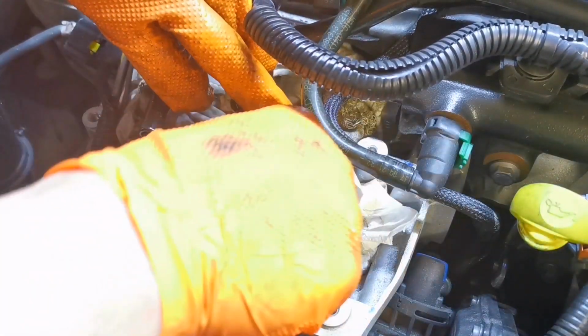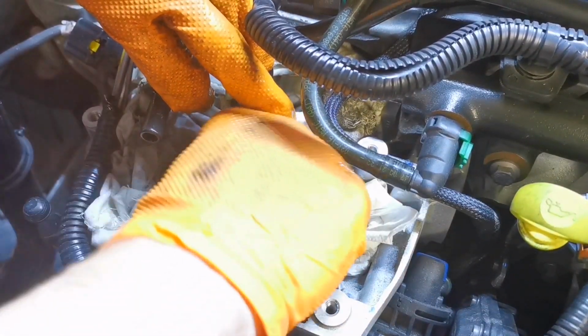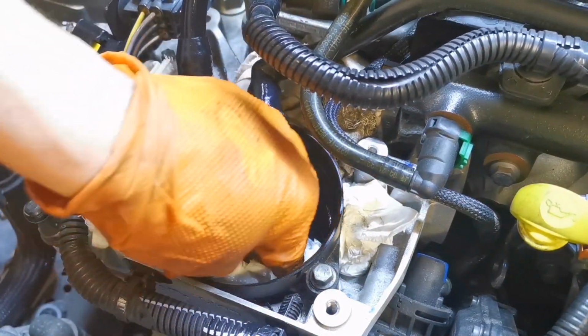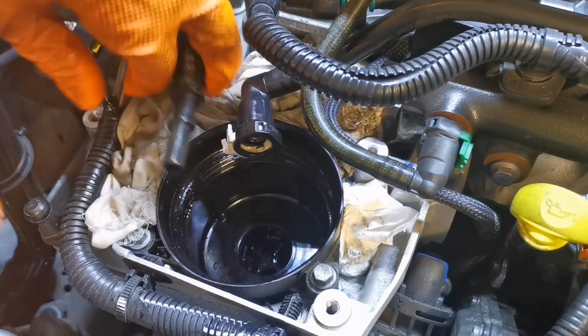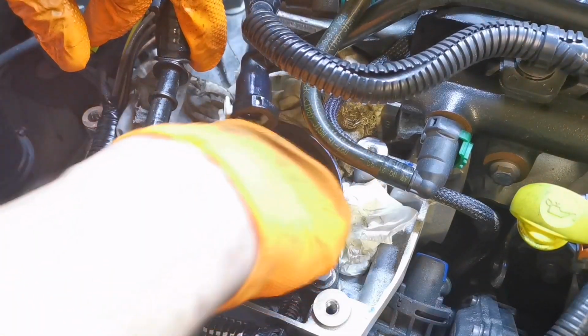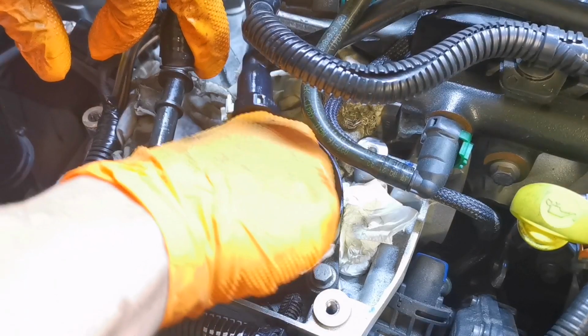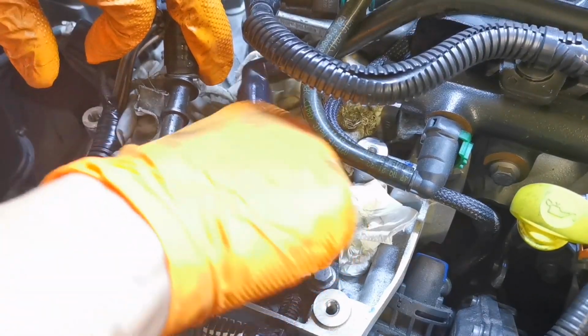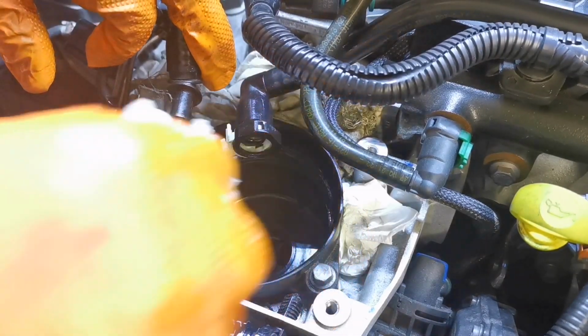It was nothing really to worry about now. If you do see large shards of metal in there, it is a bit of a problem. Your high pressure pump could be breaking up. But you do normally see a wee taste of metal fines, like looking up into the night sky with stars. That's going to be present, and you get that from the high pressure pump.